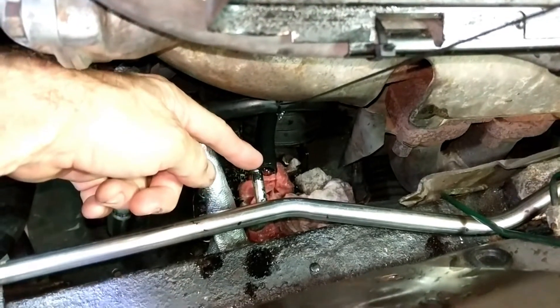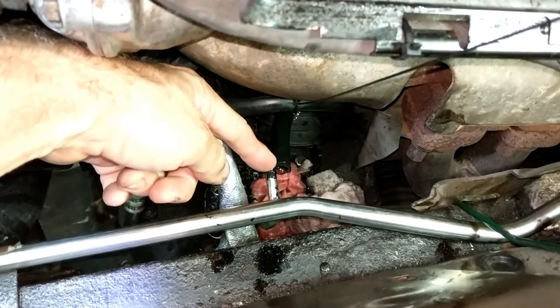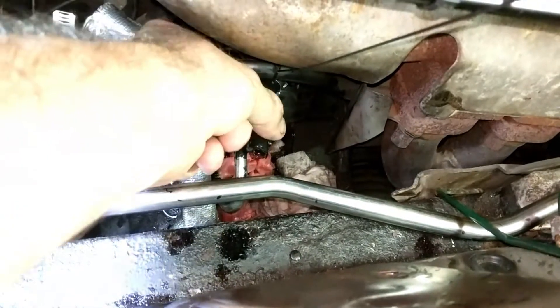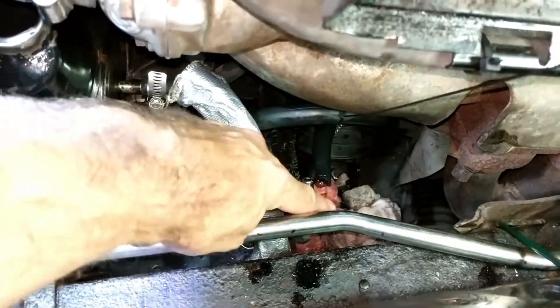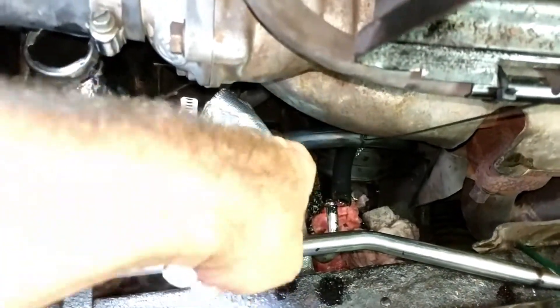A little update to learn from my experience. I figured this was all corroded up. I tightened it harder, put an extra ring on it, and the leaking mostly stopped. But the end of this pipe was all corroded, so I cut it off — you can see all the fluid coming out — with the view of pushing it on further. The only problem is it's not that long, so it doesn't go on much further. So I've loosened the cooling coil, tilted it, put the pipe on, and I'm going to tighten it up and put the cooling coil back into position. It's going to be a little tighter than it should be, but it should be fine and hopefully stop the leak.